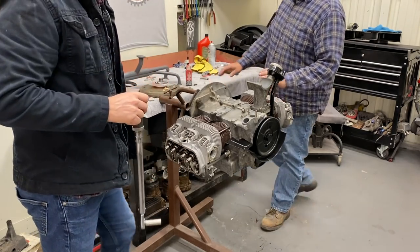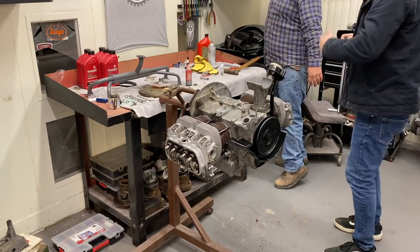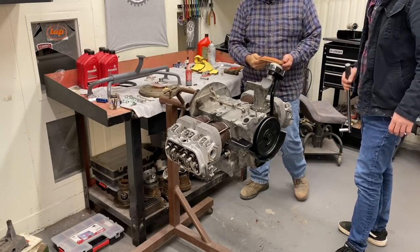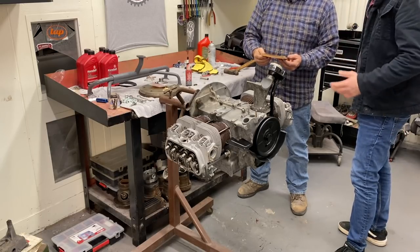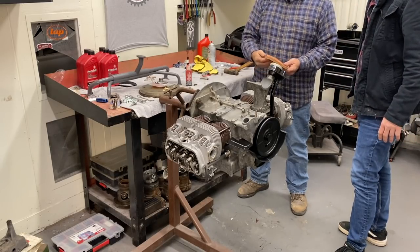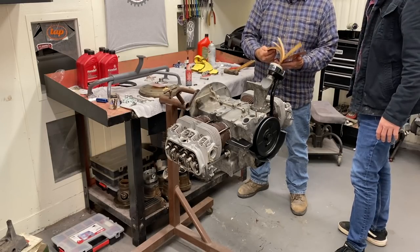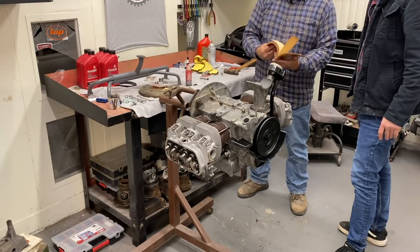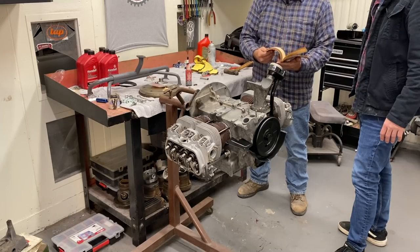That's the factory setting. You can refer to this book. This is the book I like to use. Everybody asks me what books I use, and I like the Without Guesswork manuals from Volkswagen. It's probably similar to the service manual you have. You can go online and look at these, and you type in your car, and these have all the specs for your car: the crankshaft measurements, ring and pinion backlash, any kind of measurement that's in the car is in this book.